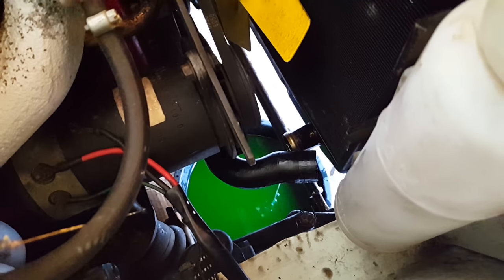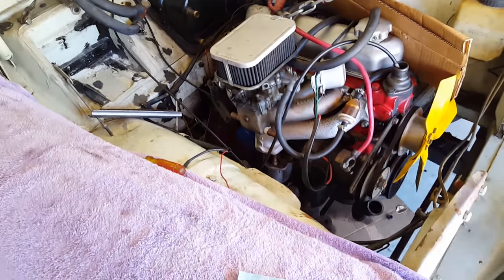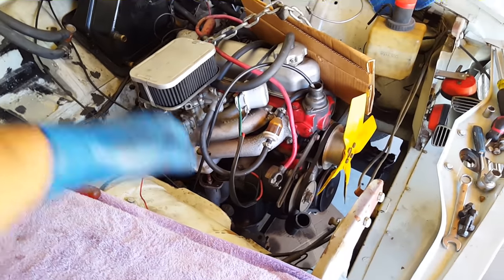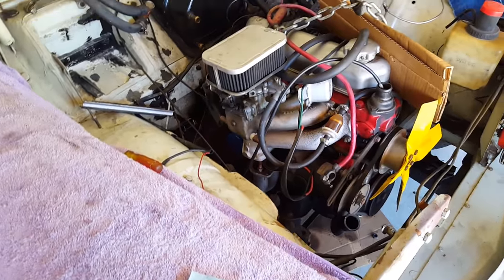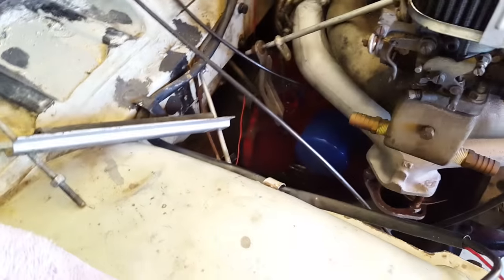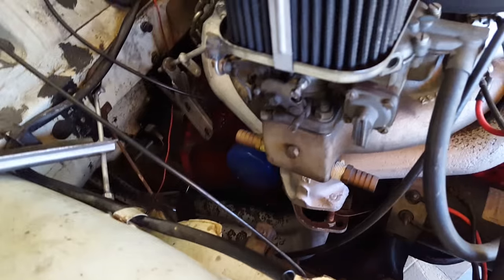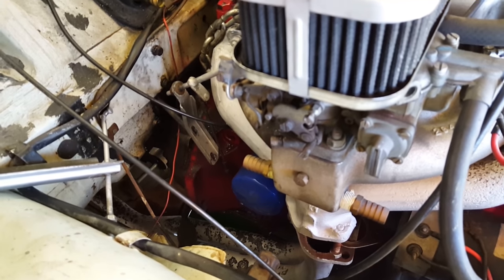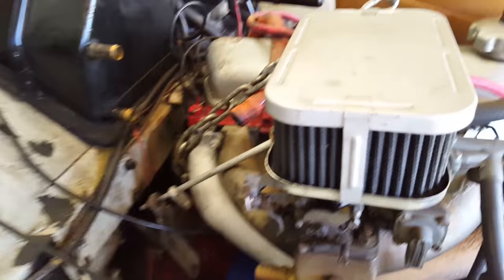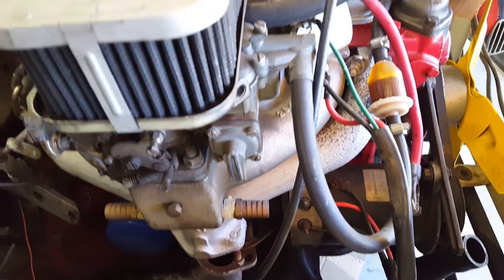If you're in the front pushing, or in the bottom pushing, it's just not working very well. Whopping two hours later, everything's been taken care of — disconnected, radiator support, radiator, all the downpipe. Nothing broke, nothing was bent out of the way, so it just worked really well this time. We disconnected the bolt on the cross member and then dropped the cross member with a jack underneath it. That jack is going to keep it from tilting too much to the point where it hits the brake junction on the firewall or the heater hoses. Now we'll start lifting it up and out.